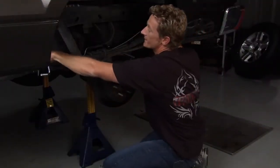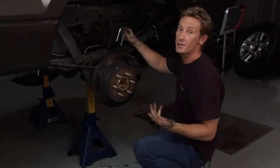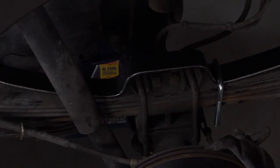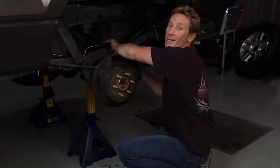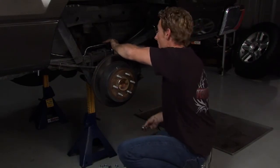Now that you've got the preload set on the outside and you don't hear any rattles, you know it's safe to go ahead and put the inside ones on. These are the half-inch U-bolts — a little bit stronger because you're going to need to handle a little bit of load, and you've got the wider crossbar. Once you run them down, you want to torque them down to about 50 or 60 foot-pounds. Then you can go ahead and double nut them so they won't come undone, and you can set the truck back on the ground and you're simply done at that point.